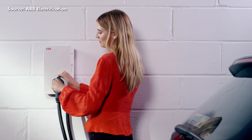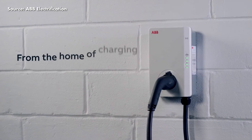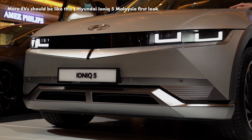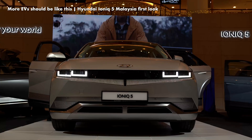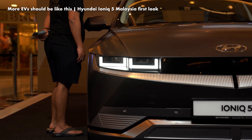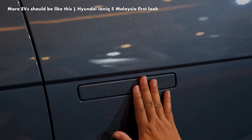To do this, it's highly recommended that you install an 11kW or 22kW wallbox charger at home. Using a 3-pin charger or a level 1 charger at 2.3kW may not be fast enough to juice up the battery before the next day. As an example, on the Hyundai IONIQ 5 Max review unit we received, an overnight 8-hour charge only pushed 20%, which has an equivalent range of 100km. It is okay for emergency use or if your daily commute is less than 60km.